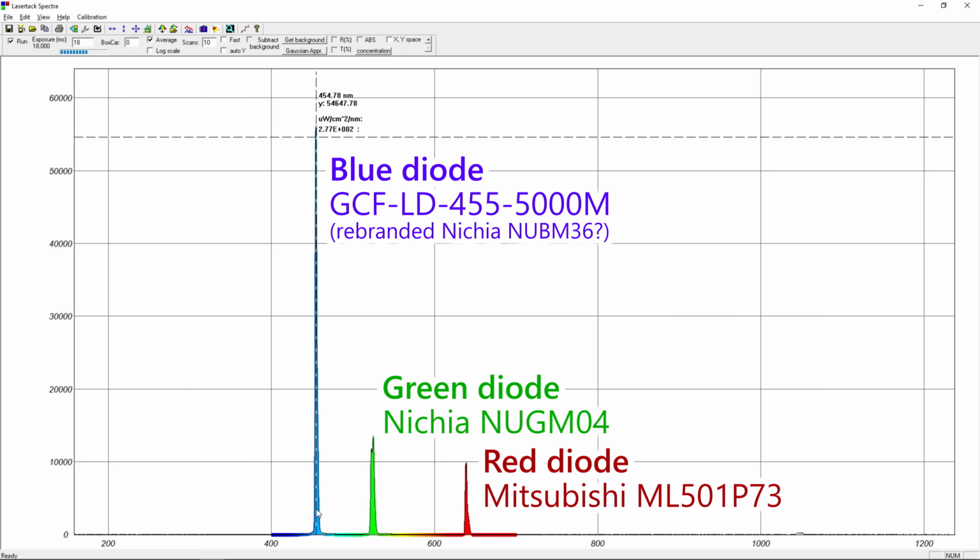My power meter needs 10 to 15 seconds to fully heat up to display the actual power of the beam. At only 5 seconds, it will be at around 92%, so hopefully we will see 6.9 watts after 5 seconds, if the laser truly is 7.5 watts. My laser safety glasses only protect against the blue and green lasers, not the red, so I will hide my head and eyes behind the laptop's screen. Ready to go. Will it reach the confirming 6.9 watts?